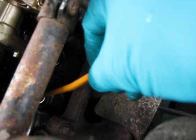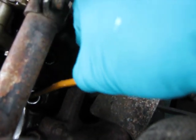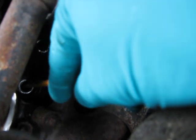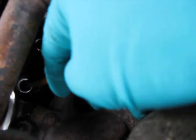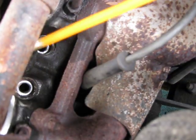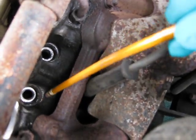I've got all my spark plugs pulled and in the first cylinder I can just put the pencil down there. If I turn it and forget the pencil, it's not going to cause any damage to the threads — it will also make a snapping sound and let me know that I need to pull it out or back off. The rubber eraser on the bottom also gives me some tell-tale signs of carbon off the top of the piston.